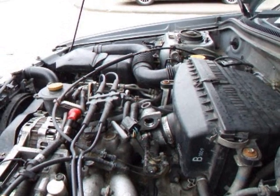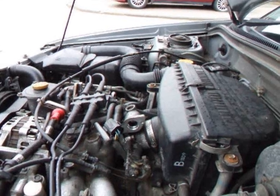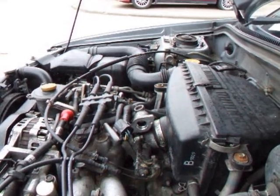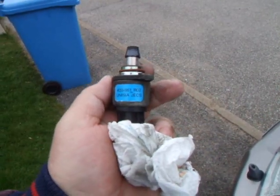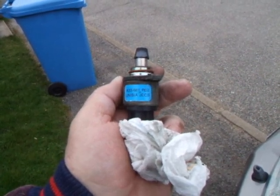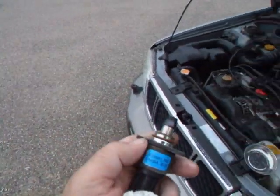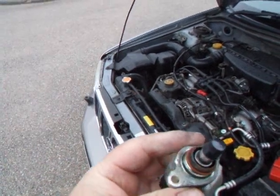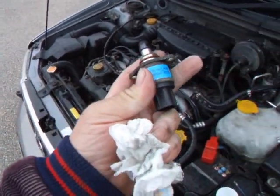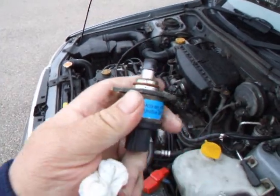When you start it up, because of all that carb cleaner, it can make a lot of smoke and it can struggle to start. But if it does struggle to start, you just put the foot right to the floor and hold it there and it will eventually kick into life. Now, I know this is the part number for this one on this particular model, which is A33-661R02. There are various models for the Forester — this is the one for the 2001 model and my one. Anyway, yours should have some kind of identification on it too. So if you're going to buy a new one, buy the right one.